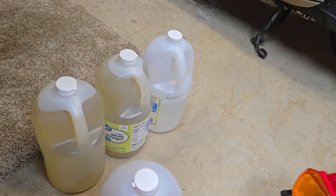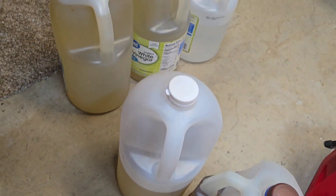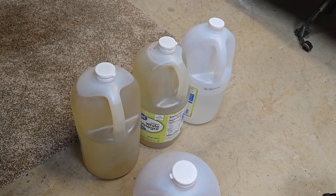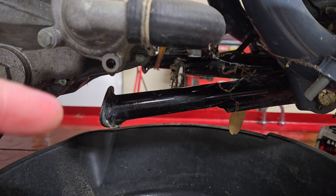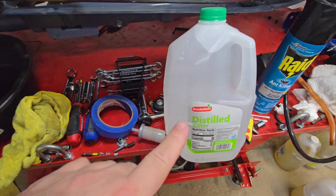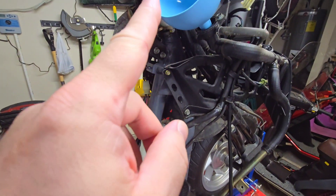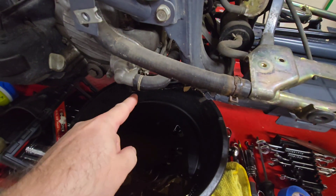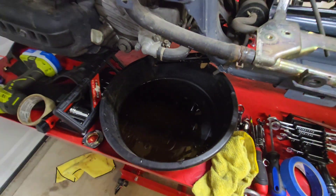I never did show you the rusty-colored vinegar that came out of the gas tank — add that to your potato chips, a little extra iron in your diet. Now let's put some distilled water through it, get it all nice and clean. We'll add it down into the funnel until the water starts coming out instead of the sludge. When it's a nice crystal clear color, we've got it flushed out.